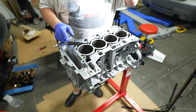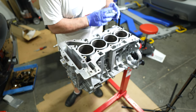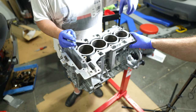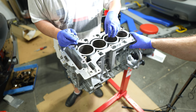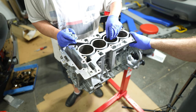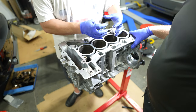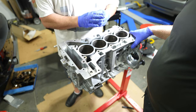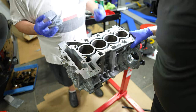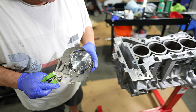We'll put it together, and then we're going to drop it in, and then we're going to spin it in the cylinder. The crankshaft's not in there right now, and the squirters aren't in there, so we're going to drop it in. And then we'll see how it spins. That's the poor man's way to make sure that the cylinder hasn't gotten out of round. It hasn't egged itself in any way. If the piston spins perfectly, then we should be good. So you're using a special ring tool to put the ring back on? Correcto.